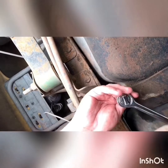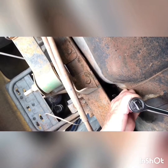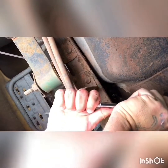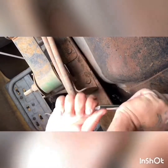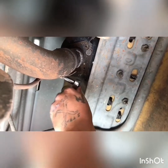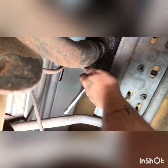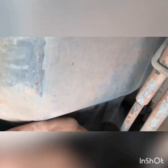15mm. Disconnect the fill tube — it's just this 8mm socket here and this hose clamp. Now I got the bolts out, you can see the straps are loose. Now carefully I'm gonna try to get these straps out the rest of the way and set the tank under the ground.